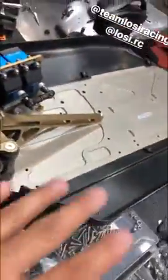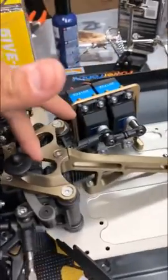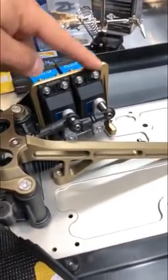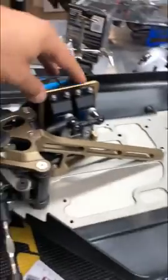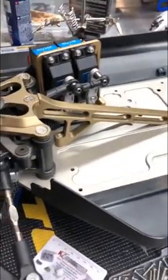So we got the first stage done from this to this. Boom. Check this thing out. We obviously didn't have to put a gas tank because this thing is going to be electric. We did a couple upgrades. The top plate, center brace, super important. And we also wanted the servos to be held a little bit more securely. With the plastic, it shifts a little bit too much, a little squiggly. So this is going to be a lot stiffer, a lot better.